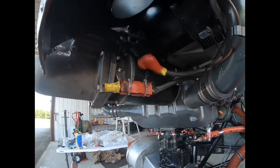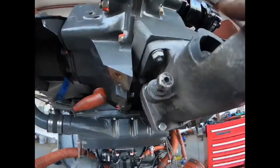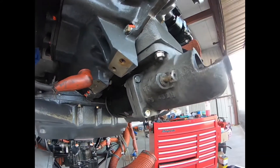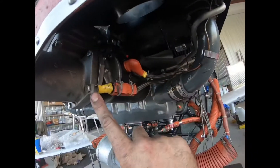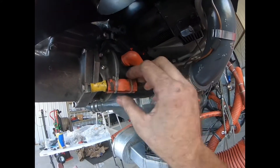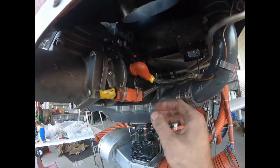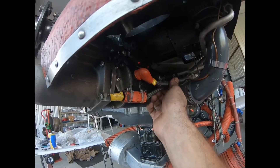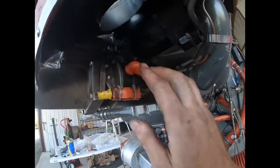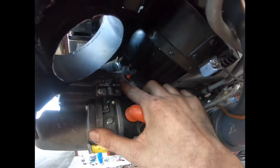The starter is mounted. We've got our mounting bolt and nut here, mounting bolt there, mounting nut and stud — those are all torqued and we'll torque seal them. We've got the ground cable and the power cable. I got a little piece of buffer there because it goes right across the housing, so that'll help keep it from chafing. Next we'll secure these cables with adel clamps along the sump. There's also a mounting bolt here for the throttle or prop cable that goes into the case half.